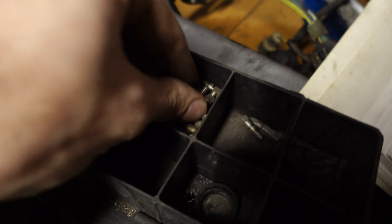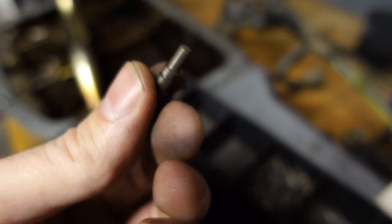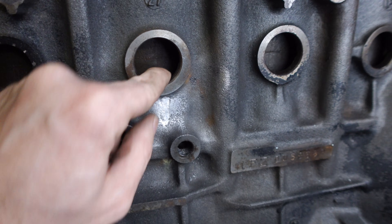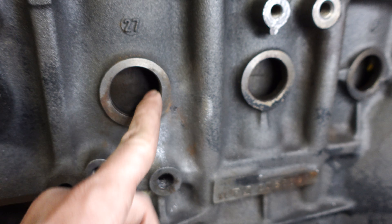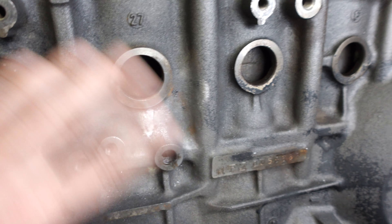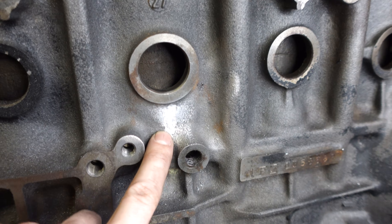I reached out to Lock and Stitch and they told me that these are Cast Master C series pins. They sent me the instructions with the right pins for the freeze plug area — those are going to be an L series pin, which I don't have. Not to mention, I don't really trust myself doing the inside of that bore and getting it all perfectly round again for a sealing freeze plug. So I am happy with this result. I could have gone further with it, but this is what we're going to be settling with.